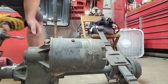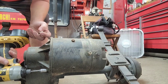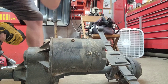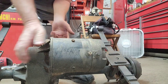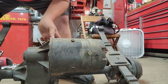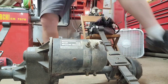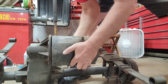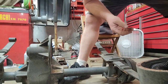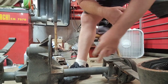There are three bolts here that hold the motor to the actual housing — the differential. I'm going to pull these three and keep the washers on. That one was already loose because that's where the strap was holding all the wires going to the motor. Now that the bolts are out, let's see if we can get it to turn — she's stuck on the shaft sometimes. There she goes. The splines look good, bearings sound good and feel good, so I think we're all right.